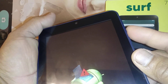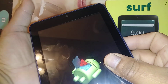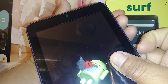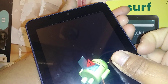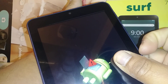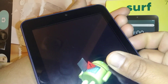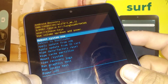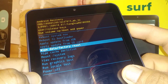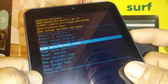From here, press Volume Down and Power key at the same time. I want to use three fingers — with one finger I'll press Volume Down, another presses Power, and then a third finger comes in to press and release. You'll see your recovery menu on the screen; release Volume Down and Power immediately. Using Volume Down, highlight Wipe Data / Factory Reset.